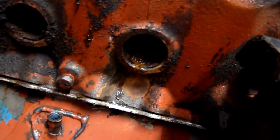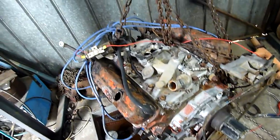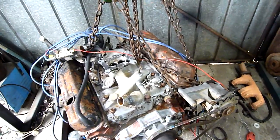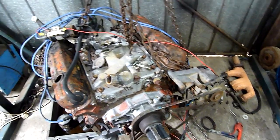I'm going to knock those Welch plugs out and replace them — I've got a bag of brand new ones. Apart from that it seems to be fine. I think it's just got a sticky or gummed up valve from rust. There's a bit of rust on the ends of the spark plugs, two or three of them. That was the worst one. I pulled them all out, cranked it over with some WD in the cylinders and she came up pretty good.